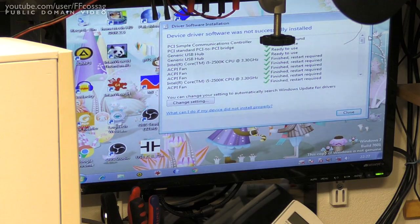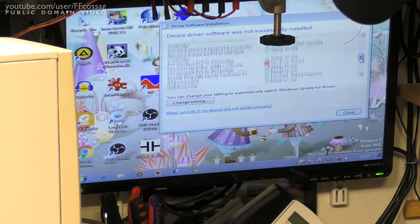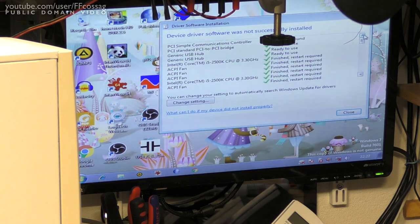Well, color me surprised, Windows from the AMD build decided to just boot with no mucking around at all and install a whole heap of drivers. So that's a lucky thing, because this is a fresh Windows install. I don't need to reinstall this. But I would not have imagined the ability to straight up copy with no interaction at all a Windows install from an AMD FM2 platform to an LGA 1155 platform.